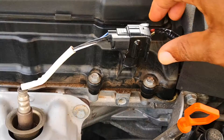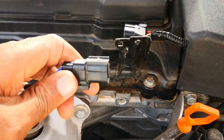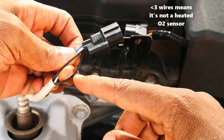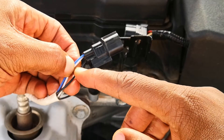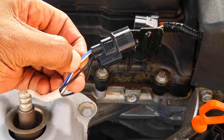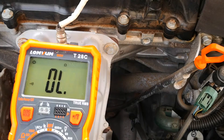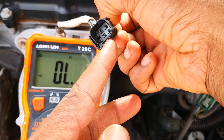Let's start with a known good sensor — the one on this 2017 Accord. I'll just detach the connector for this upstream air fuel sensor. Heated oxygen or air fuel sensors usually have at least three wires; as you can see, the one I have has four wires, and other types may have more. The most important thing is to identify the two wires for the heater circuit — they would usually have the same color. In the case of these Honda sensors, black is the color for the heater circuit. If you have a three-wire heated oxygen sensor and no two wires share the same color, you might need to check online to find out which wires correspond to the heater circuit.